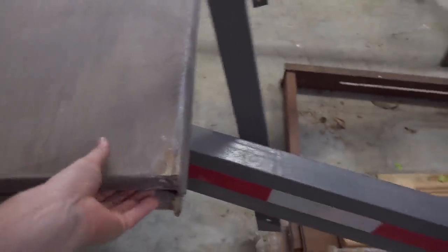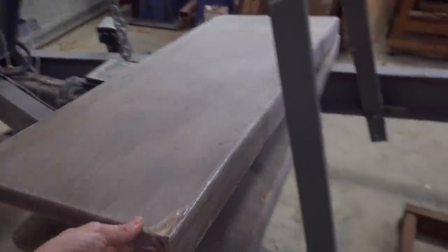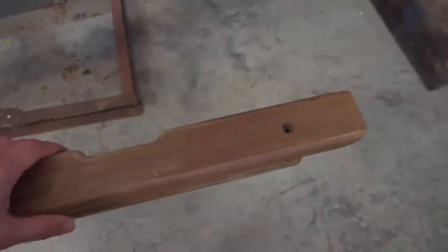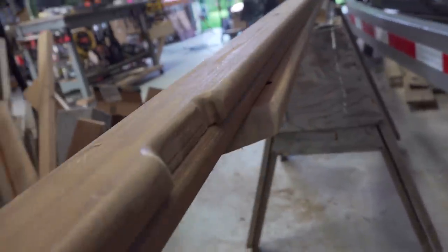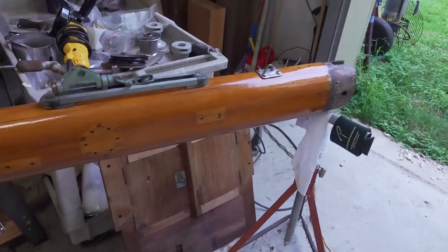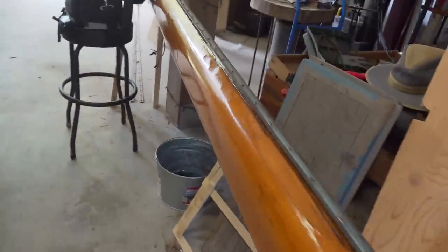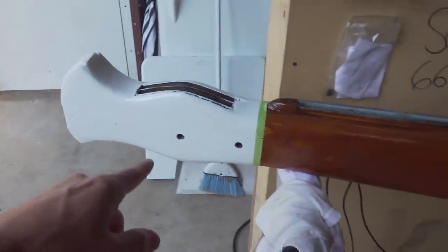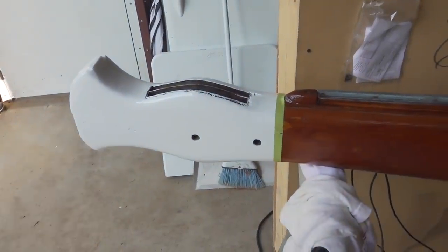I've got these locker lids cleaned up - I just need to do some fairing and then we'll be able to paint these. We're ready to install the rub rail now. We got it fitted and I've gone around and gave it a nice radius on both sides and made all the cuts I needed to. The mast is finished now - I just need to keep adding the hardware back in. I've got this old track back in place and it looks pretty cool. I'm also working on painting this top part - I just need one more coat and then we can install the masthead fitting.